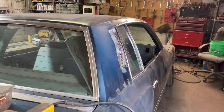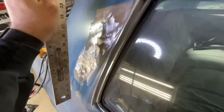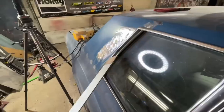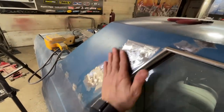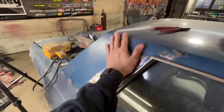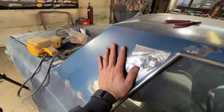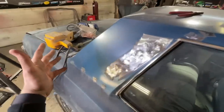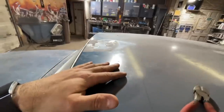We basically got it — I'll do it a little bit more and then put the straight edge back. Check this out — we went from a two-inch dent to essentially none. It's still going to need body filler — there's still a couple little waves — but I could technically get it completely hammered out. This car is going to need body filler in other places anyway, so I'm really happy with that. I was not sure how much of that was going to come out. Going into the roof dent knowing how much the metal can move — I'm used to working on older cars and I forgot how thin the metal is on a '79.